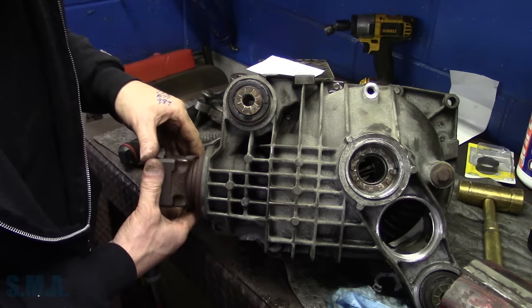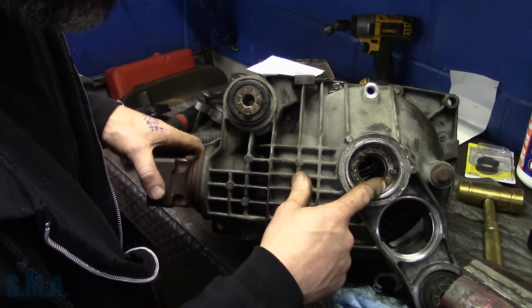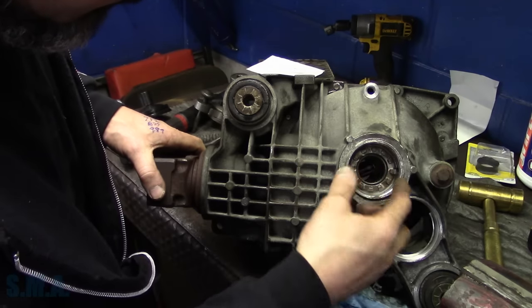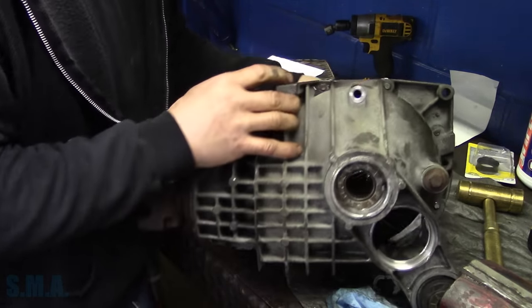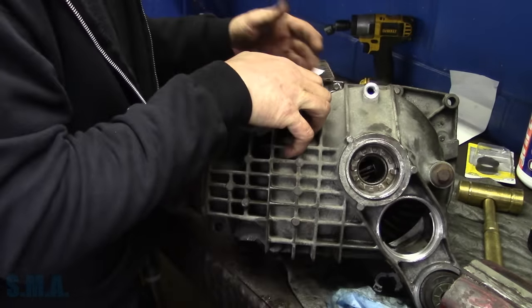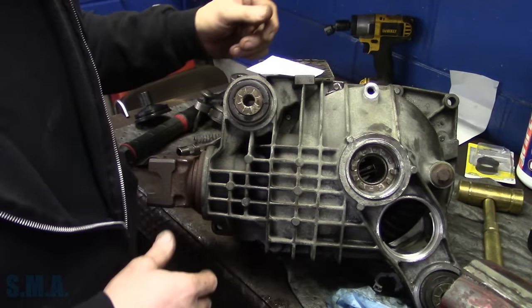We have to be super close. If not, I think it said that we get 3 thousandths change for each notch that we go, and you can see we're not even on a notch. We're not on a notch on that side. We're not on a notch on this side. But being that we're on the low end of our rotational drag, we can always tighten them.